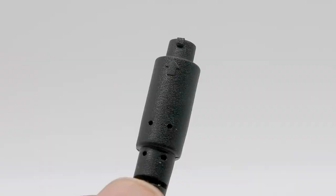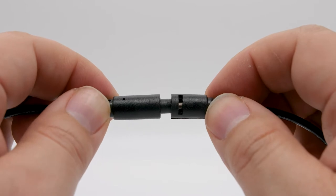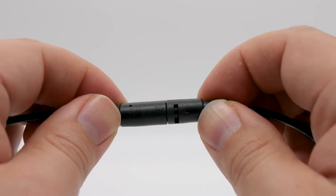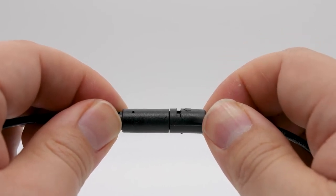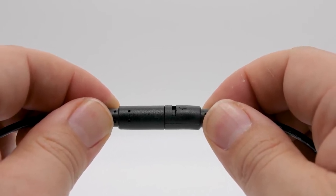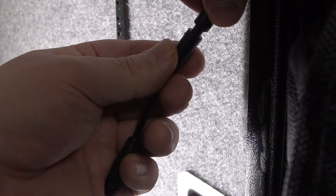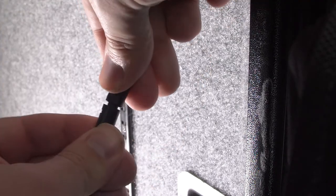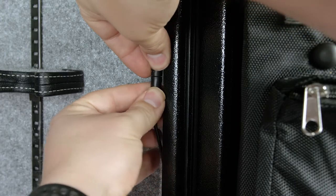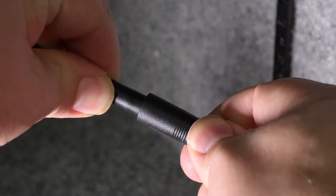With everything in place, connect the wires. On each cable connection, you'll notice a small arrow. The arrows are an approximation and do not line up perfectly — you'll need to slightly rotate the connector until the notch and lip line up. Once the small lip is through the notch, rotate the connector clockwise until it stops. This secures a proper connection. Since the hinge lights are oriented differently to accommodate for the screws, a 3-inch female-to-female adapter cable is provided. You'll use this to connect the motion sensor to the lights. After the lights on each side are connected together and connected to the motion sensor, plug the AC adapter into the motion sensor.